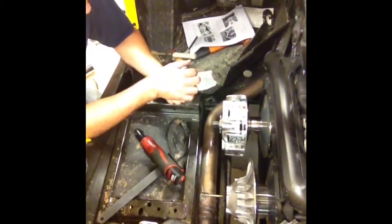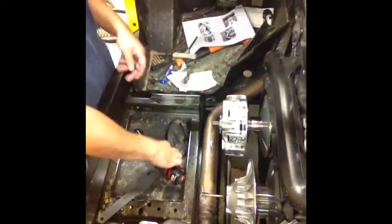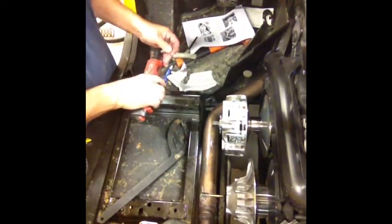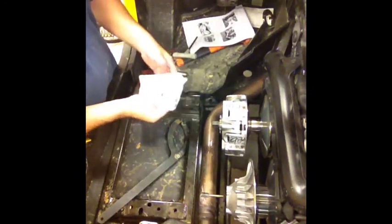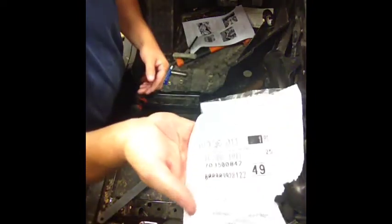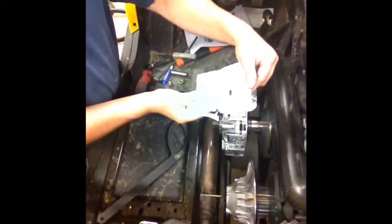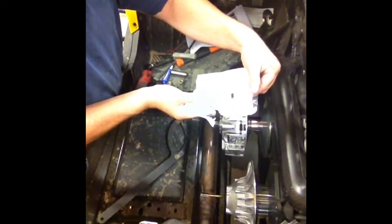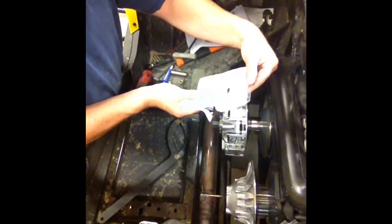So when you open up your case, if you happen to have the new stud on, it'll look like this. The first thing we've got to do is take the set screw out. By the way, if anybody doesn't have it and doesn't want to go to the dealer, here's the part number right here: 703-500842. It's called a Clutch Bolt Repair Kit.